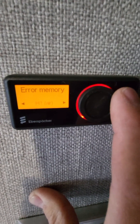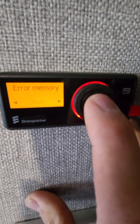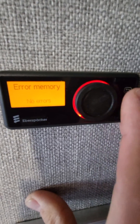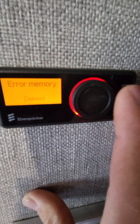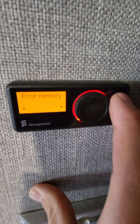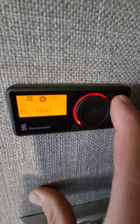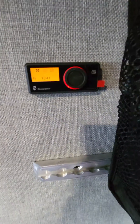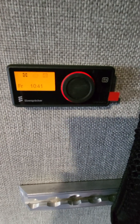And then, once you're there, scroll to the right, check the control unit, and read if there are any errors, and delete those if there are. That clears all the codes in the memory from the workshop position. So now, you should be able to turn your heater on, and it should fire up and start running properly.